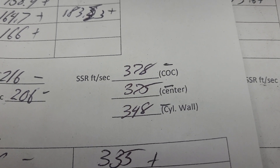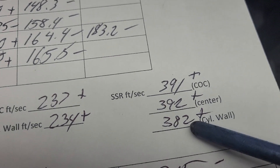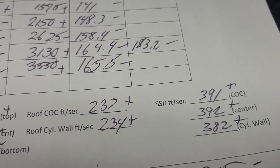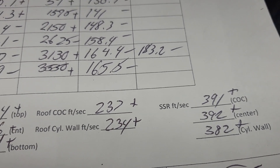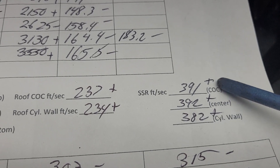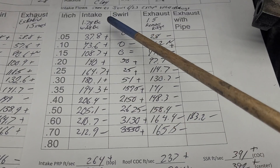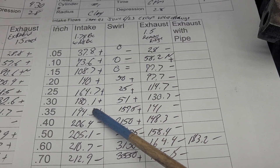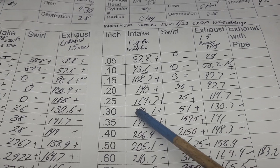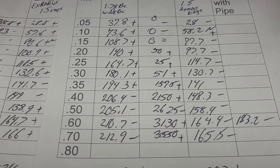How do we do on our short side radius? It's already fast here — changed the valve and it went up. It's definitely starting to really cook, faster than I'd like. I've already made that wider but I haven't done much of a lay back yet, though I may. I have to look at DV's and how much he laid his back — remember, as soon as you start laying it back, all of these lower numbers start to drop. We're only at 180 at 300 lift; I'd like better than that, but it's a small valve at 178.